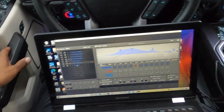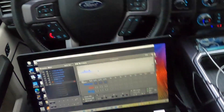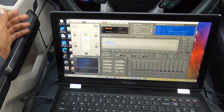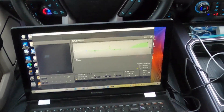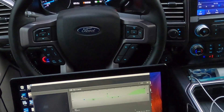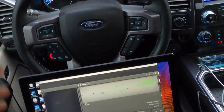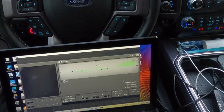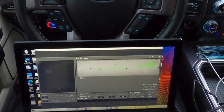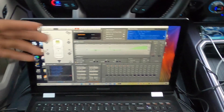On the sub, a lot of times subs don't need a ton of equalization, so we gave it some small adjustments here and there. These are on the outputs per channel — you can see left, right, front, rear, sub outputs. On the Virtuoso you also have a main EQ. The main EQ lets you give customers adjustments based on what they want — it's on the output only. So if you want to boost a little bit across the whole system without touching the radio's bass control, you can do that here.